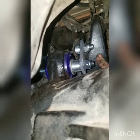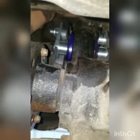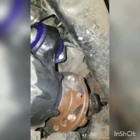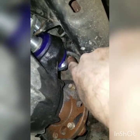The rounded corner allows this to slide in around the engine mount without having to do any grinding on it. We didn't want people to have to modify anything, so these are bolt-on. As you can see, we have the top lock nuts in and the bottom bolt in. That one is all connected — the only one that's different is that front one with the rounded corner. On the back one, the instructions will show a place where I recommend you just file a little bit — that's on the driver's rear mount right here. Just file it just a little bit.